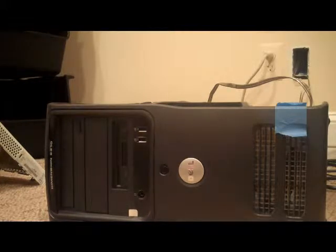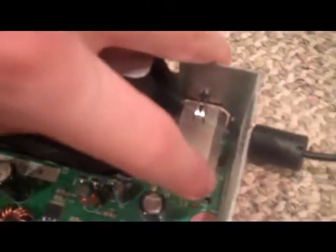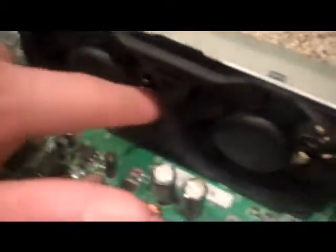I'm gonna try this one because I still gotta do some LED modifications, and I'm gonna put a JTAG in for this person — that's what they ordered, that's what they wanted. I'm gonna upsize the voltage on the fan by connecting a red wire from the AV cable port, sliding it all the way through this hole here on the back end, and it's gonna reach back to the front to make this fan go from 8 volt to 12 volt — much better and increased cooling.